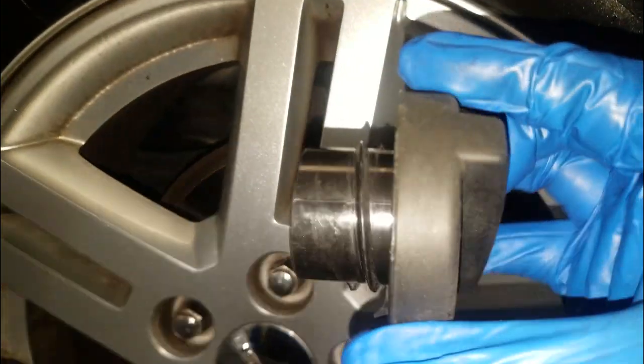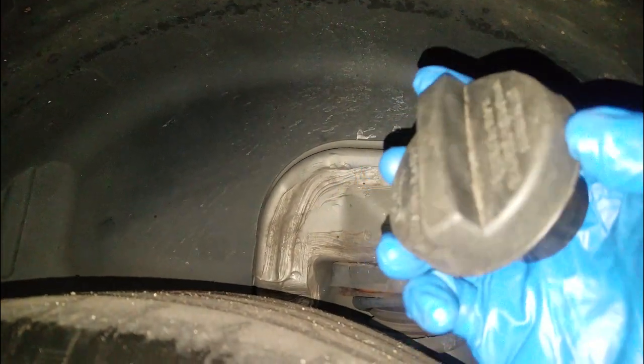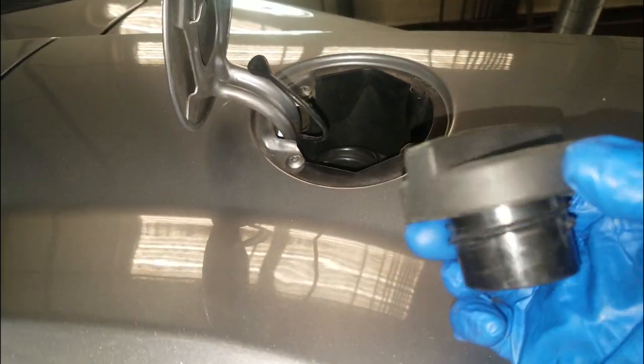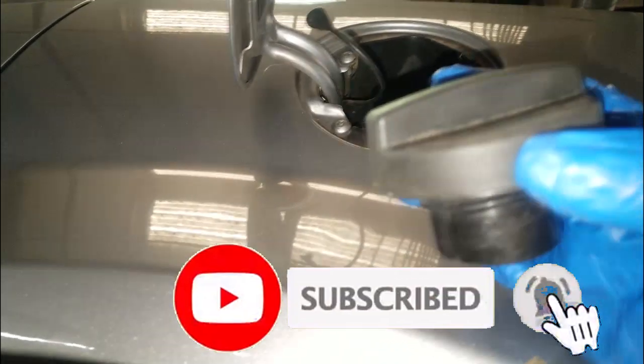So what I'm going to do is write up a gas cap. You can see a cut on the seal — this gas cap is no good. Like I said, she says she just replaced it. I'm going to write up an estimate on the gas cap and whatever else I recommend. I'll keep this video simple and get more in depth on another video as far as EVAP leaks go. Thanks for watching — come and subscribe and I'll see y'all on the next video.